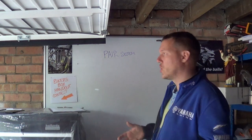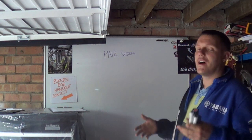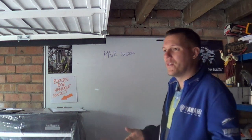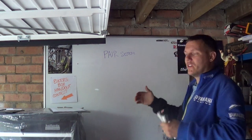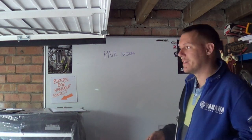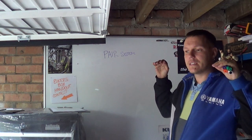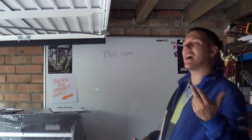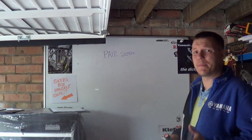What Suzuki and other companies decided to do was address the biggest failure of this function — shutting your throttle and your ECU being a bit late to the party. The problem is these hydrocarbons. If you burn them, the products — CO2, water, carbon oxides, nitrous oxides — aren't as bad as hydrocarbons, just basically pissing out fuel. So what they did is, when you close off the throttle there will be a vacuum situation, and what they do is pump in fresh air from your airbox into your exhaust.